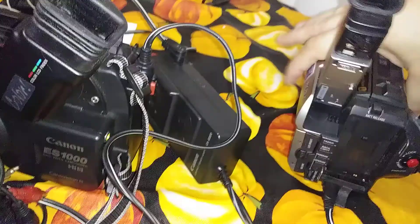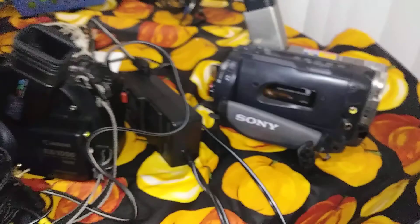Here's how we do it. Get your good old-fashioned high-quality 8mm tape. We're going to stick this one in this camcorder to record — this one has a VCR function. We turn it to VCR and flip up the top to access the record button. These are the old cables you'd use to do this sort of thing — nothing like HDMI. This is all analog, but it was the best analog that ever lived. I can't use S-Video because this one only has composite. The best was component with RGB, but component is dead and this is what we're doing.